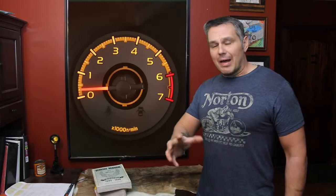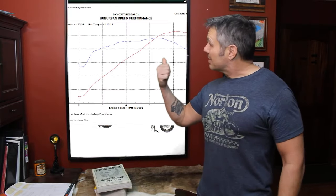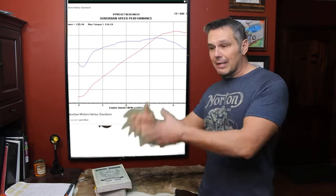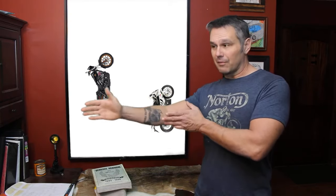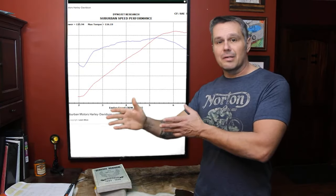And so I know that my RPM is going to drop to say 4,000 and some change. And let's say I'm pulling ahead and I make that shift. Well, in that shift I'm going to lose a little ground, at least a little. And so if I've got this thing coming alive at around 4,000 RPM, and that's where its max torque is, and it stays pretty close to that, then when I dump that clutch, I'm going to gain that ground and put me back where I was or even further ahead, because that's at my maximum torque. And then as it starts to drop off a little bit, my horsepower is still increasing. As you can see, it's very smooth and linear, and as it's increasing, I may be gaining a little ground, but then I make another shift, okay?